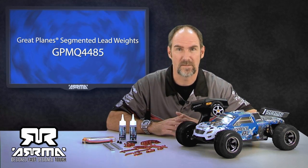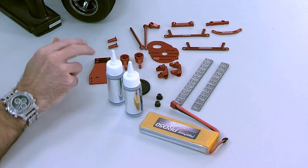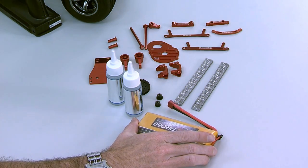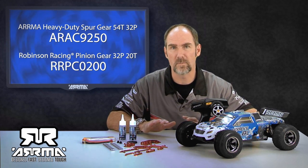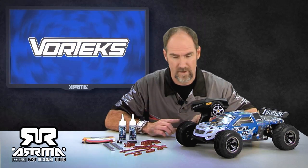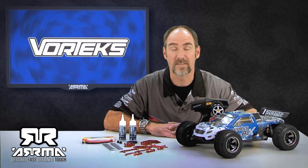Now let's get into the bread and butter of what's going to make this truck go 60 miles an hour. First thing that's going to make the biggest difference is a three-cell LiPo pack. You have to make sure you get the right one — we're using a Flight Power 1, a three-cell pack, which will actually fit into this battery box. Finding the exact pack that will fit inside the battery box is the whole key. The next thing we're going to do is change our spur gear and pinion gears. We'll mess around with them a little bit and let you know what we come up with after we do the runs of what actually achieved the 60 miles an hour speed. So I'm going to head over to the R&D department, bolt everything on, and then we're going to hit the track and see what we can do.